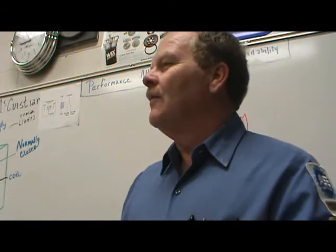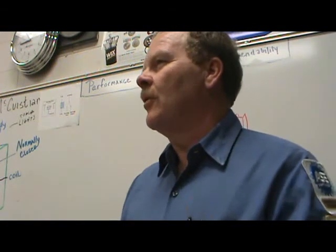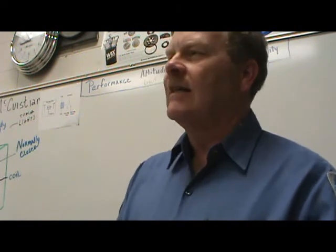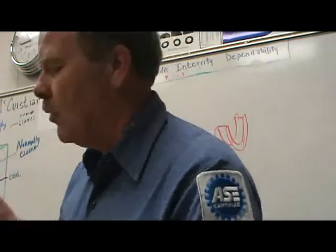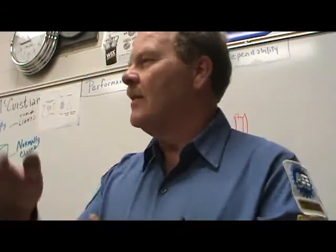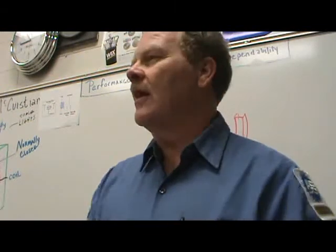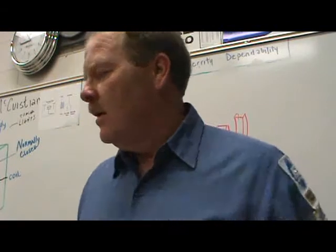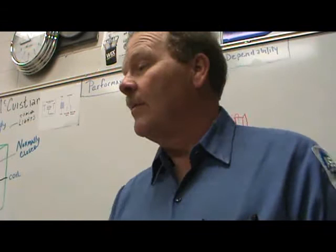No, it wasn't a final. We had just torn some engines apart and put them back together. I think some of the high school guys did it. When I say something is really important, make sure you put the caps on right, the tangs have to be together, the pistons have got to be facing the right way, and all that kind of stuff. Then I come back later, and they just put the pistons in any other kind of way and cram them on there. But anyway, Zach straightened it all out when he pulled them all and put them back on right.